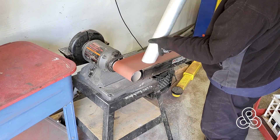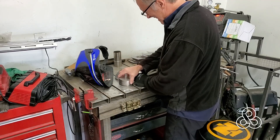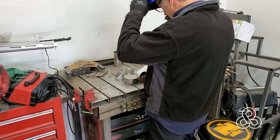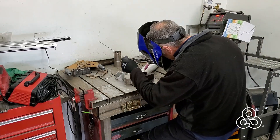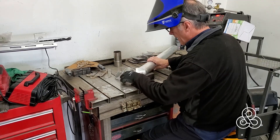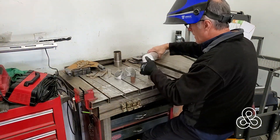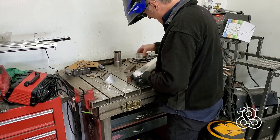Once they're all cleaned up, we're going to take them over and tack the system together. Just a couple of pie cuts going to make us three welds and create our 90 degrees. We're going to have two 90 degrees on the same plane, passing through the firewall on one side and then passing through over to the intercooler on the opposite side. I didn't get video of this, but I actually ended up cutting the ends and adding a third weld, kind of kicking up the piece of tubing at the very end there.